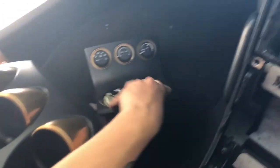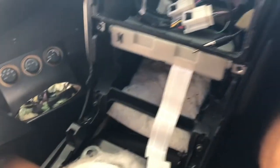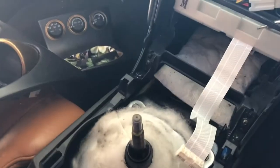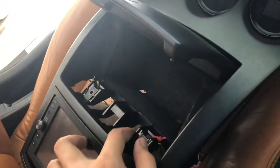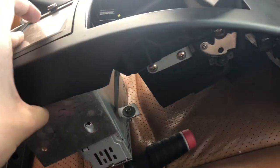To get this out you've got to just slightly pull up on your shift boot and then it'll pop right out. Unscrew your knob and throw that away — that comes straight out after you unplug this one. Then you've got two screws here and here; unscrew those. Then you've got two more screws in the middle up here; unscrew those. Then unscrew two screws behind there. There's supposed to be a bracket there but for some reason I don't have it — no idea what happened, so I've made my own dodgy little bracket behind there.